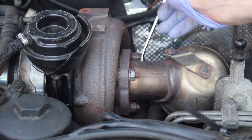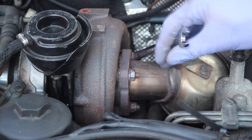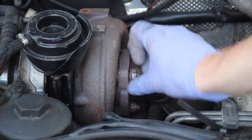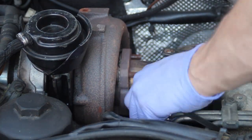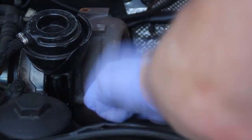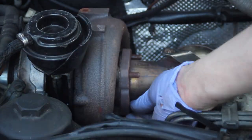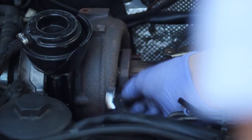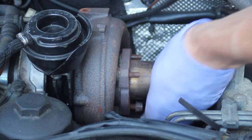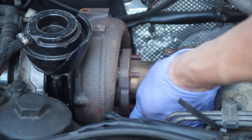The first thing I've done was to take off the three 10mm bolts on the heat shield, and we're now undoing the 12 or 13mm nuts on the turbo side of the catalytic converter. I'm just going to speed that up and get these undone. That bottom one's a little bit tricky — you may have to use a spanner. Depending on the side, I found my ratcheting spanners or sockets wouldn't quite fit everywhere, so a lot of it was quite manual. These come off quite easily; the difficult bit is what's going to come next.